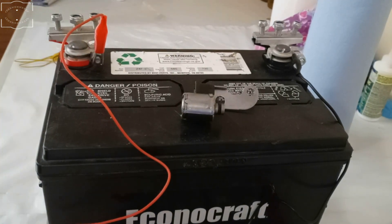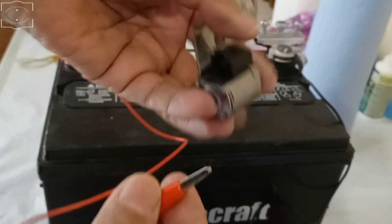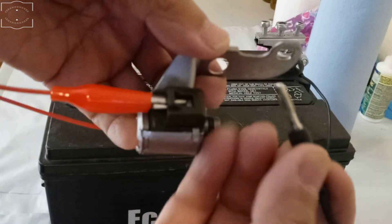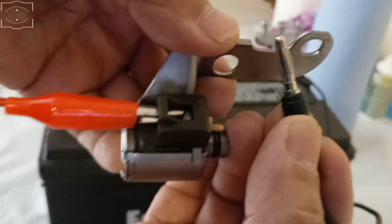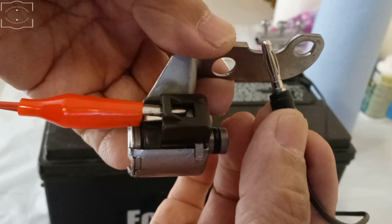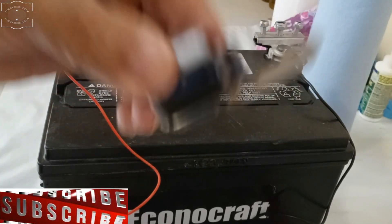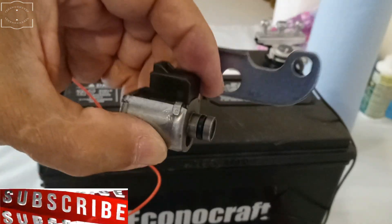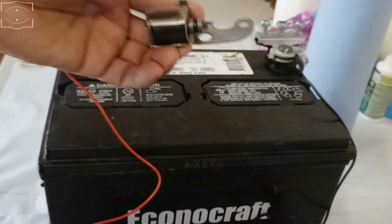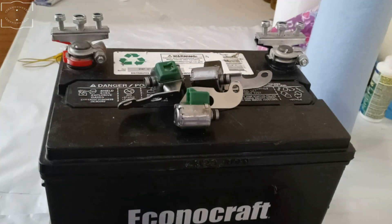It clicked — a little bit weaker, but it clicked. I'll put it aside and wait about 30 seconds before testing again. Yes, it clicked. He won't do it again as I said. But if it were inside the transmission, this shift solenoid would be clicking every time you apply 12 volts because it's installed in the valve body.